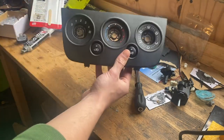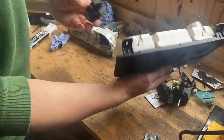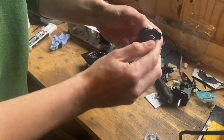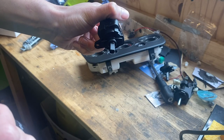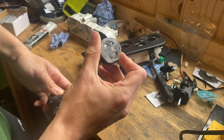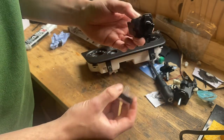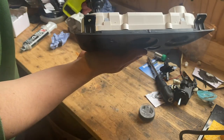I can now pop the front piece back onto the panel - four tabs hold it in - then secure it with a T20 Torx screw on the back. Then pop the fascia panel over the top for the final time, fitting perfectly, and secure it with four Pozi screws that hold the fascia panel to the white panel on the back.